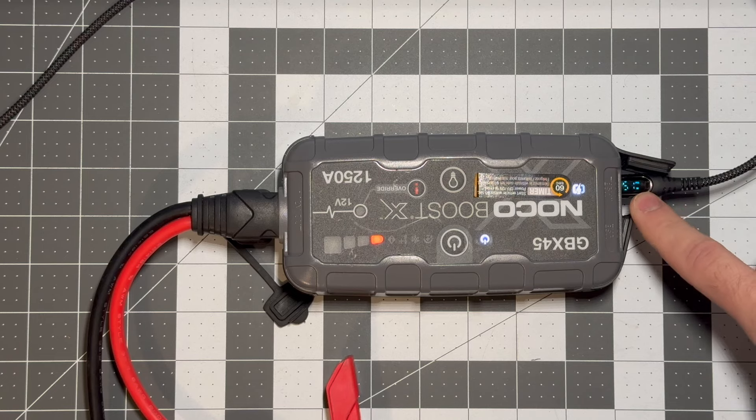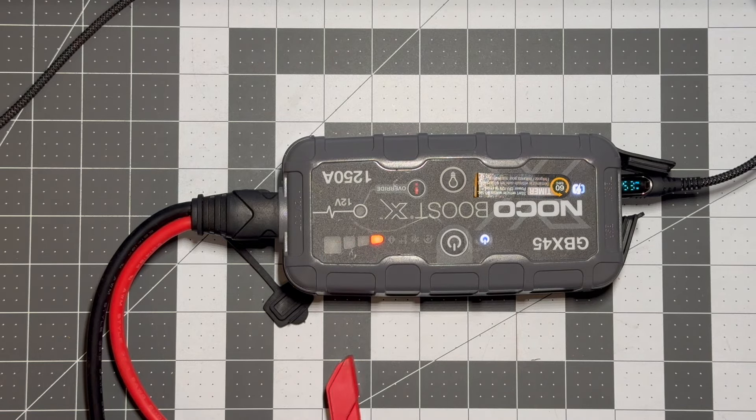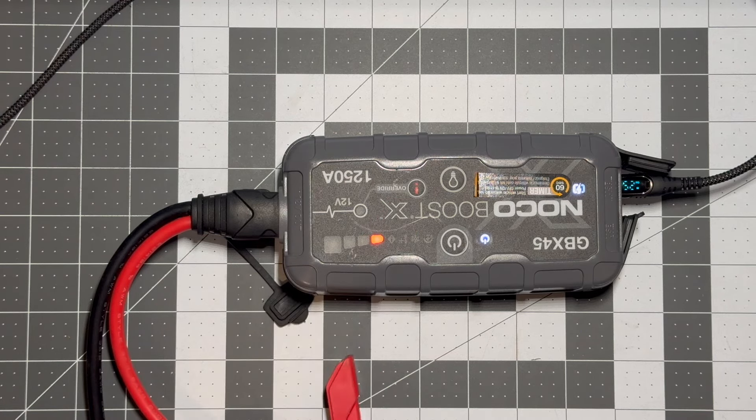The NocoBoost is fast charging now at about 51 watts and so all I have to do is wait for it to charge all the way up to the green light. Now if you want to see how I restored one of these in a more detailed way including how I open it up and charge up the battery using clamps on the internal connections as well as testing the battery capacity, look for my NocoBoost GBX 55 restore video. And if you want to see how I check out the balance on the individual cells inside this battery pack, check out the GBX 55 balance video. Hopefully this was helpful for understanding how you can ascertain whether or not your NocoBoost is charging and give it enough charge from the outside to get it to a place where it'll charge on its own. If you're inclined, hit that like button and thanks for watching.